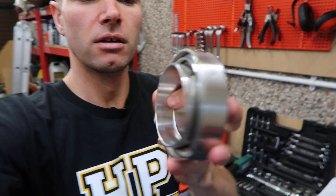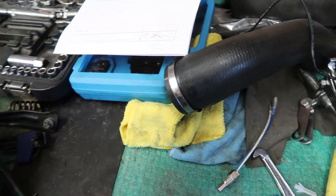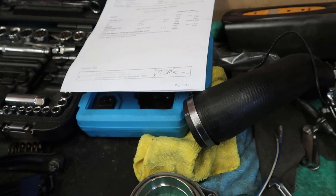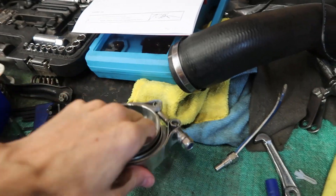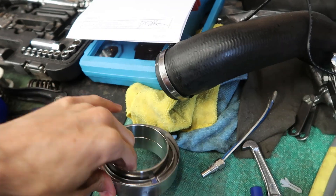You just need a couple of these v-band clamps and a universal cat — I got one from eBay for a hundred quid — and just v-band it in. Run the breather system the way I do and you should pass emissions no problem. And if you remove the cat after you've done your emissions test, it's going to last a heck of a long time because you're only using it when you need it.